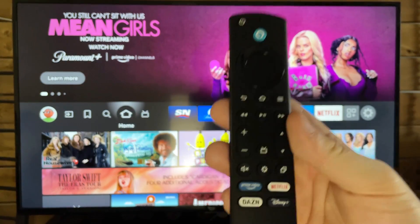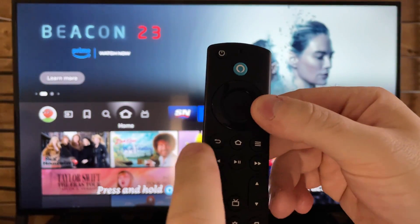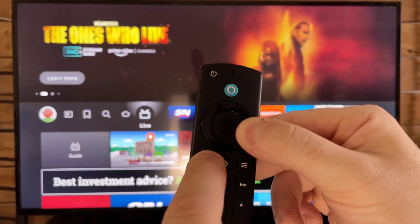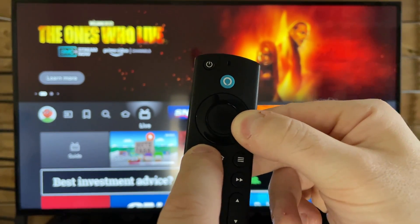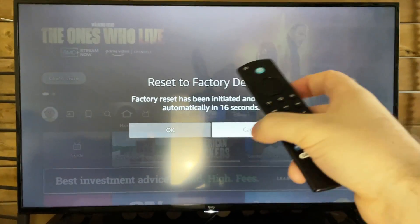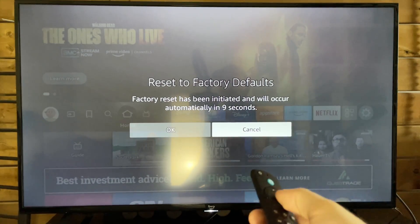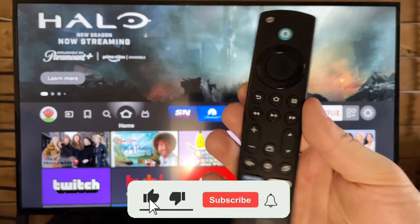If this doesn't work either, the next thing you could try is factory resetting your device. Bear in mind this is going to delete everything and it will be like when your TV is brand new. Press and hold the Right button and the Back button on your remote for about 15 seconds, and you'll see a window pop up asking if you want to reset your device. You'll see 'Reset to Factory Defaults' and 'Factory Reset has been initiated.' If you don't want this to happen, select Cancel, or if you want to go through with it, press OK within that time frame.